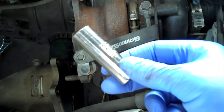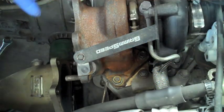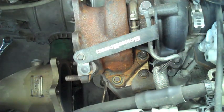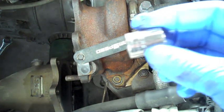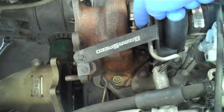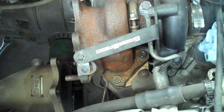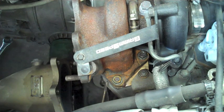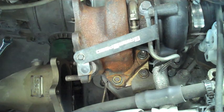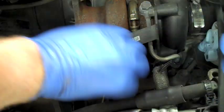There are five nuts connecting the turbo to the up pipe and the brackets. We are going to use a deep socket 14mm for the ones that have studs that stick up a little further, and a short socket for the outer ones that have shorter studs — to get in between the compressor and exhaust housing for that last nut. Do not completely remove these; you can remove a couple but make sure you leave a couple on to hold the up pipe to the turbo still.